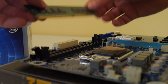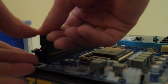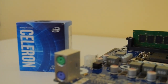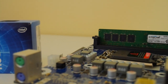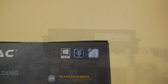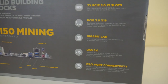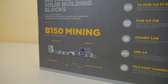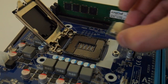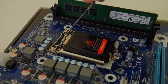It supports up to 32 gigabytes of DDR4. Currently eight gigabytes is plenty for Ethereum mining, and even less — like four gigabytes — is fine for Raven Coin, which is what we used with this system. It is LGA1151 and supports Intel 6th and 7th gen Core i3, i5, and i7 CPUs up to 65 watt TDP. That's purely due to the four-pin CPU connector — it's meant for lower power consumption CPUs. The particular CPU we used was the G3930.